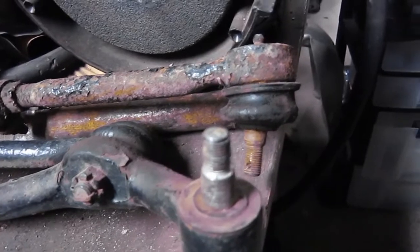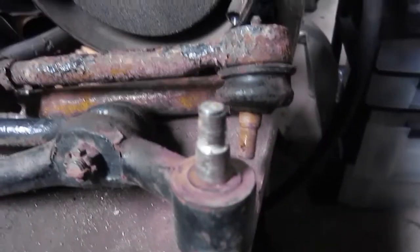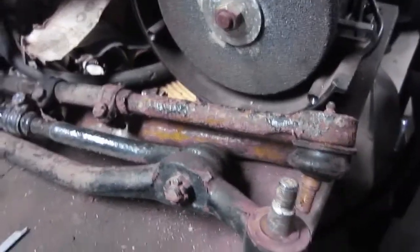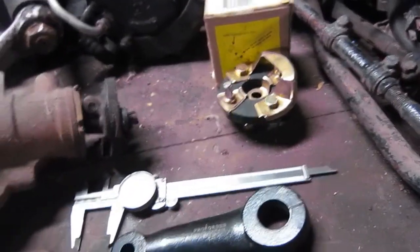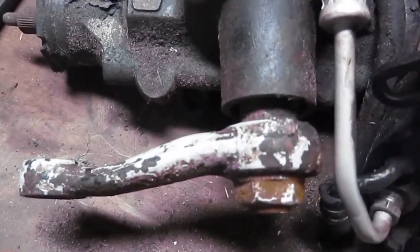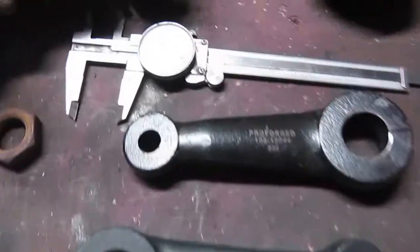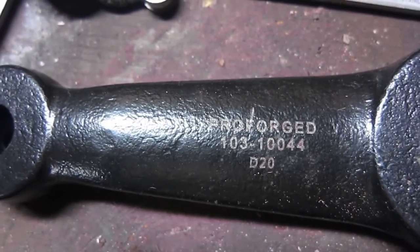The power steering is a larger diameter tapered pin, and they make a smaller diameter for the manual — but it also turns out there's a bigger size, the same size as the power steering, on some of the manual steering boxes. I found out that my 66 had the same bigger tapered size pin. So your major headache is going to be finding the right pitman shaft. On the power steering box it's going to be bigger on the splined end and a larger taper on the bottom of the pitman arm. I found this part number on some forums saying it would be the right one for my car, but it turned out not to be — this one has the smaller sized tapered pin.